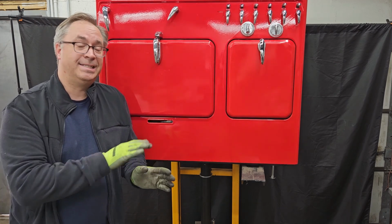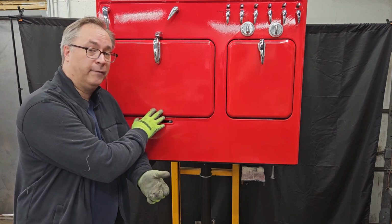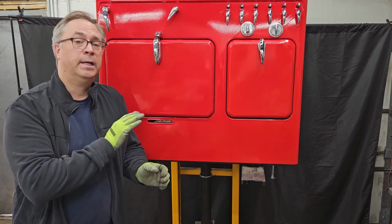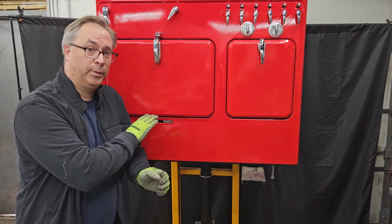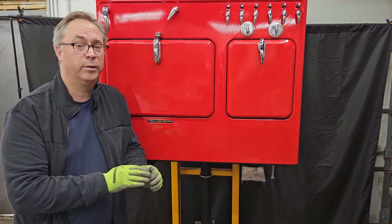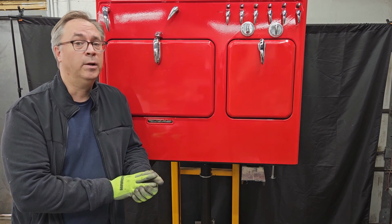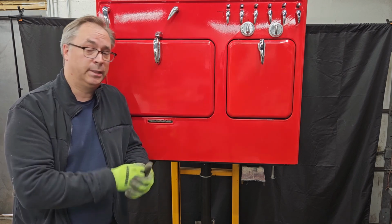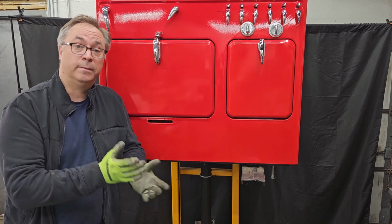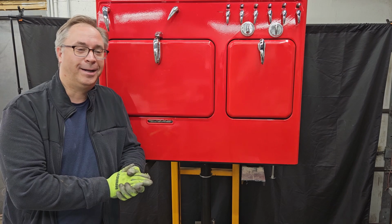You will see in some forums now and then people still quoting an old misconception that it'll prevent the oven pilot from blowing out because of a draft. I just want to make it very clear that if your oven pilot will blow out because of a draft, you have a much bigger problem than whether or not you have a skirt, and you need to call somebody who knows how to work on these to solve it for you, or you need to do a deep dive into the manual and solve it yourself. Either way, the skirt is just a decoration. But it looks nice and people like them, so it'd be handy if you knew how to put one on.